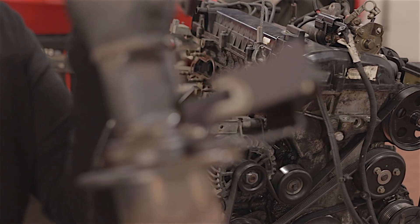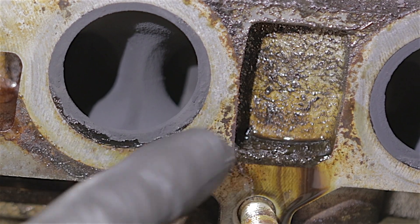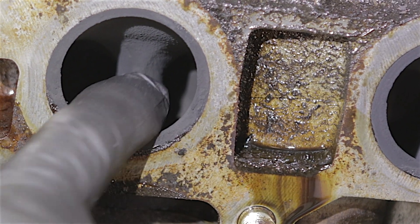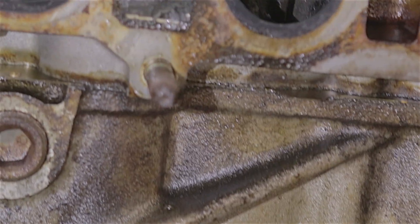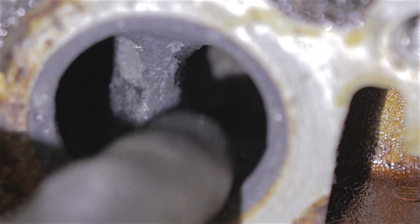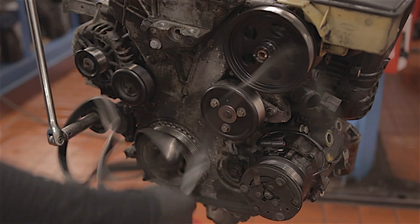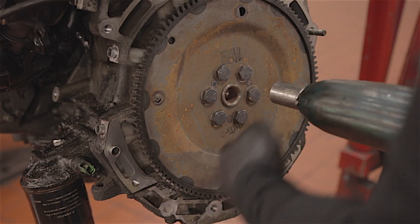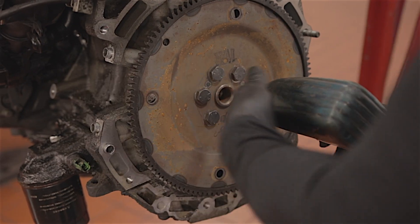I guess I'd better put this out of the way of prying eyes. Well, if I look at cylinders 1, 2 and 4, they all look nice and the same colour — basically a nice light darkish grey. But cylinder 3, if I go up to where the exhaust port is, it looks very much like water's been coming out of this cylinder. Because this engine's rocking about too much and it's doing no good for my camera stabilisation, I'm going to get this off and put a stand on this engine to hold it secure.